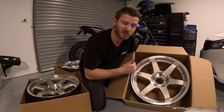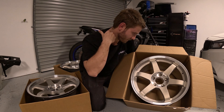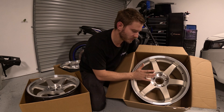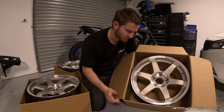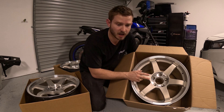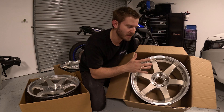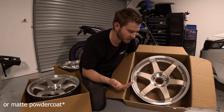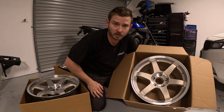I'm going back to my powder coating idea. They're never going to be original bronze — they're obviously replicated. Through research on Google and Facebook, I found a company in America called Prismatic Powders. They have a color called bronze chrome — you powder coat the wheels in that color and then during the drying process, while the wheels are hot, you paint them with a matte clear which gives them the finish. I'll put a photo on screen of what I found.